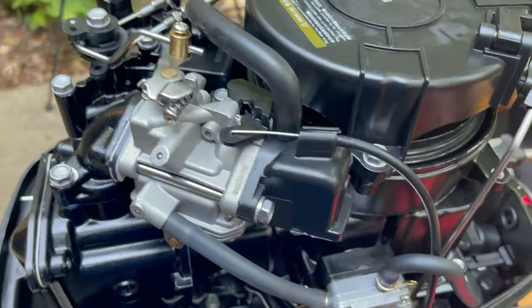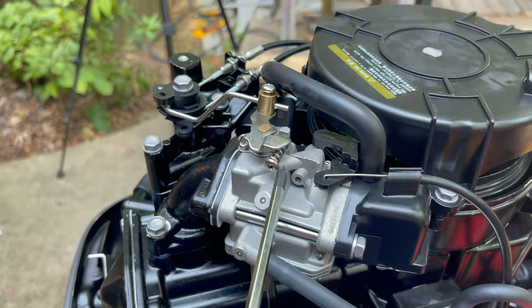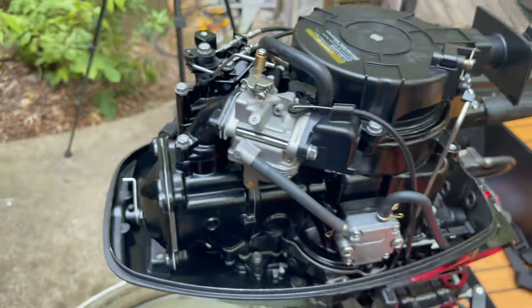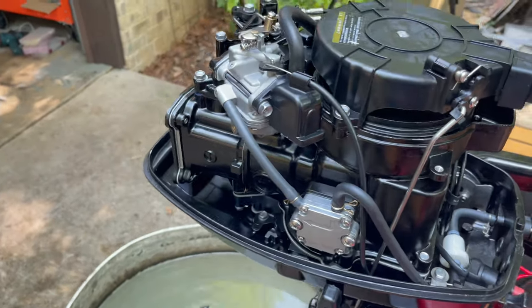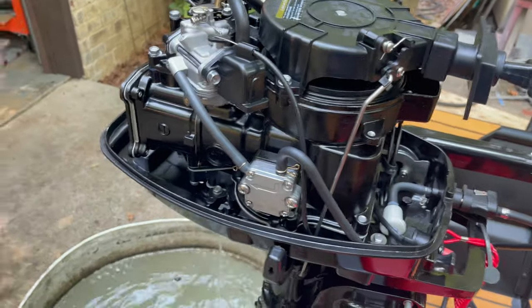So as you could tell, one thing, they got this sticker backwards, but another thing is how high it was revving up. And this idle speed was pushed way too far in, so I unscrewed it some and it seems to be fine now. Let's see if we can crank it up with me holding this. Yeah. See, that sounds a whole lot better.